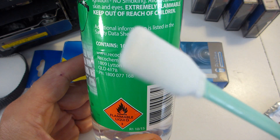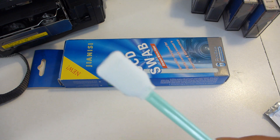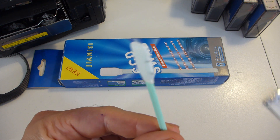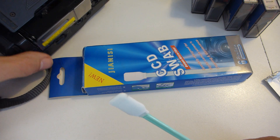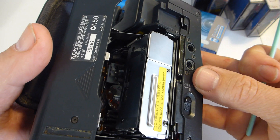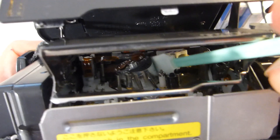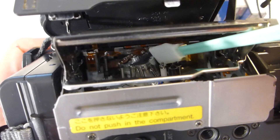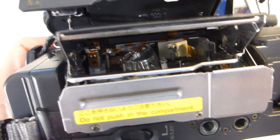This is a CCD swab that has been used before. Essentially I'm going to have a bit of blind faith and assume that it's clean and give this a crack. If it doesn't work, I do have a mate with a cleaning tape he's prepared to post to me as a second option. And if I can't get inside the gizzards of the camera, I'm going to dismantle the mechanism and pull all of the outside componentry off. I can get my little swab in there and I can turn the head, but I can't really get any contact. You've got to go with the drum direction, which is counter-clockwise — you can't rub up and down. So I don't have a choice, I'm going to have to dismantle this thing.